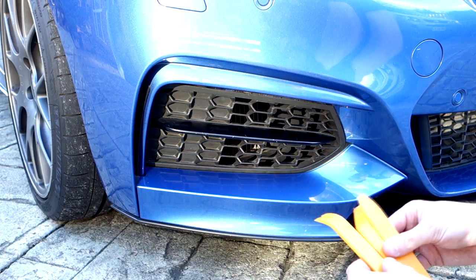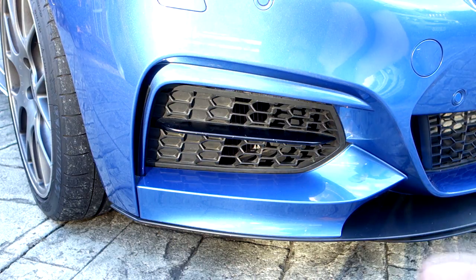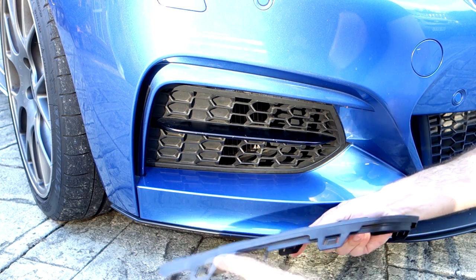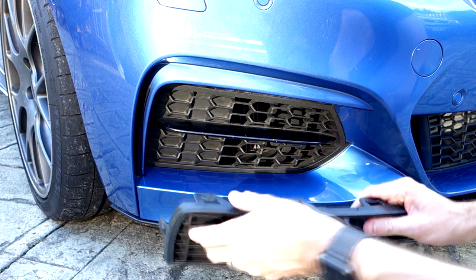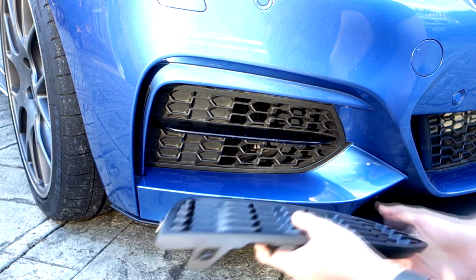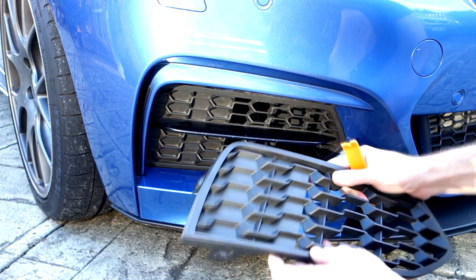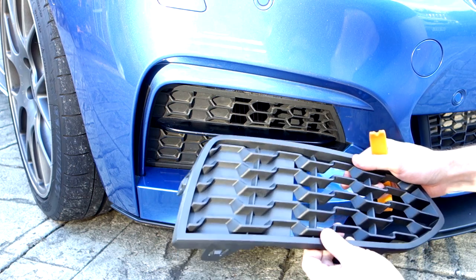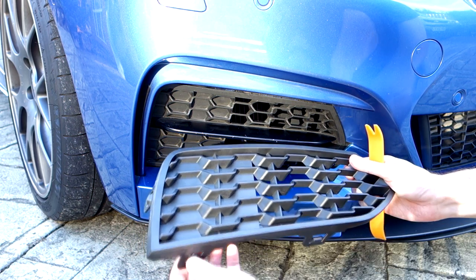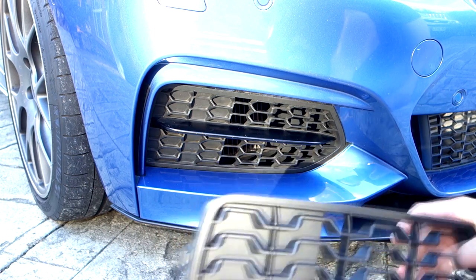I definitely recommend having a beer or two before you do this. What I did was wedge in this little card here as well, just to give me something to leverage against. As far as the clips go, there are three along the top, one on the front side just here, two along the bottom edge, and then one on this side. The clips on the top and side have a pretty hard edge on the front, while the ones along the bottom have a bit of a taper — when you wedge something in it pushes that tab flat. The best method I found was to slide something into the bottom ones first; they pop out a little easier, and then you can get your hand in behind and slowly work it out.